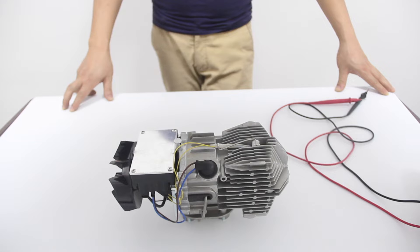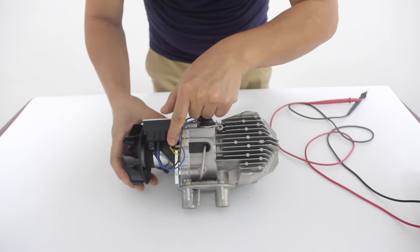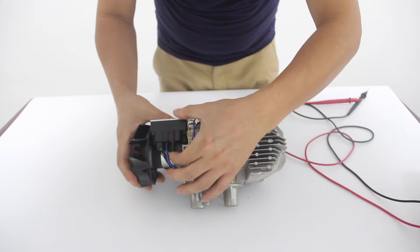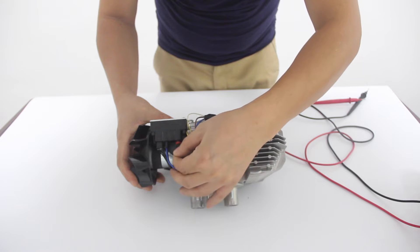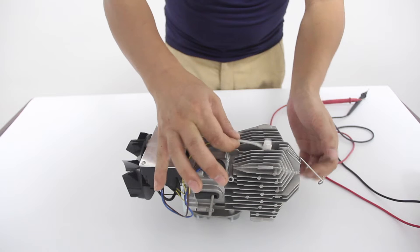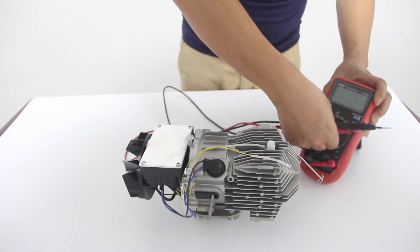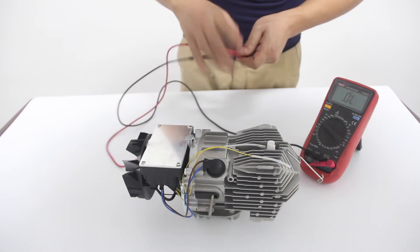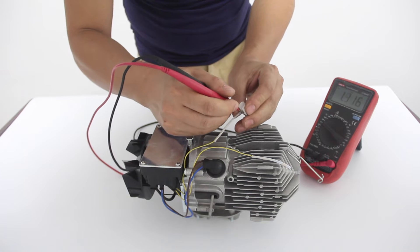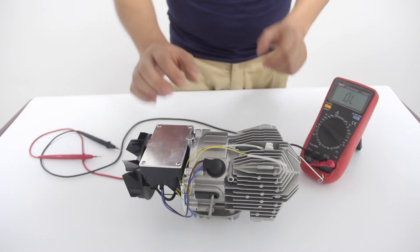To fix area 1, we need to check two places. The first is to check whether the plug is loose or in the wrong place. The second is to check whether this part is disconnected. We can use a multimeter to examine this part. If it's unbroken, the multimeter will display around 1000 Ohm. Please remember we should do it under normal temperature.